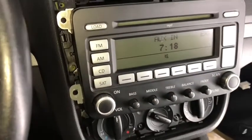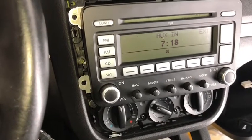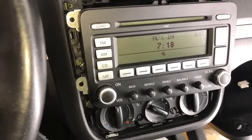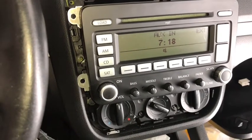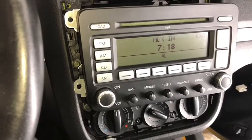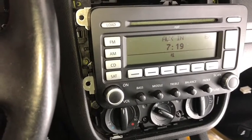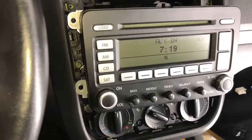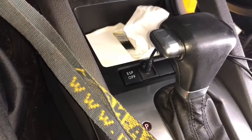This isn't a very hard install, but I looked around on the internet and couldn't find really any information about anybody moving them — or if somebody did, they went to an aftermarket head unit. But this is super easy to do if you have a factory VW head unit. If somebody could come up with a wiring diagram, I'd definitely post it in the comments — I couldn't find the color-code wiring diagram. It's pretty simple; I basically just had to pin it out and trace it back. Pull out the old wire, put in your new jumper pigtail after you de-pin it from the factory connector, and you can move your aux jack to the center console.